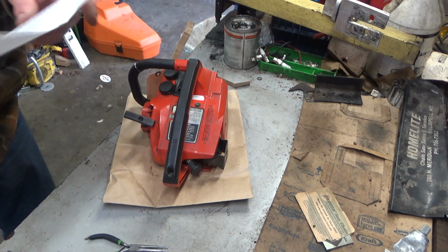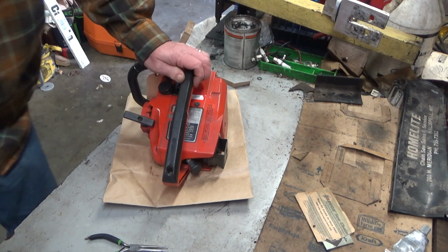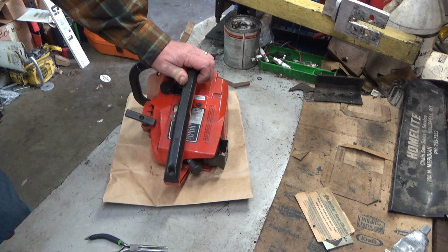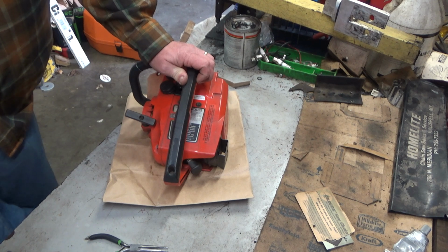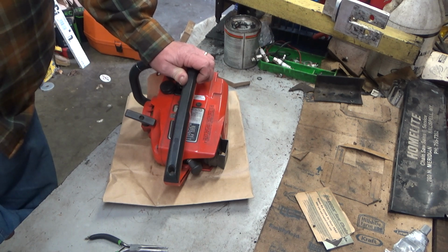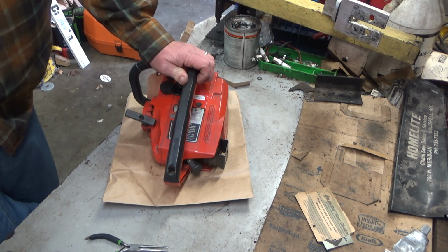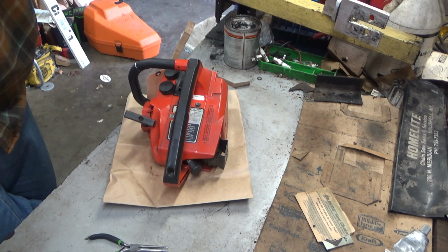Anyway, I have an 86-ish Homelite XL. It has served me well, but not working well these days. Followed all your videos, but still have problems. Mainly I will get it working. After a half hour or so of use, it will just shut down and not want to restart. Or I will shut it off and same issue. Or it will run out of gas and same issue. It may sputter but not start. I do have spark when this happens.